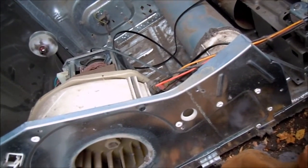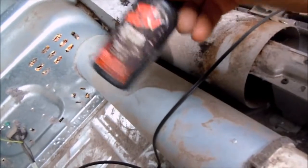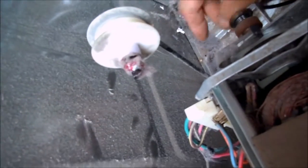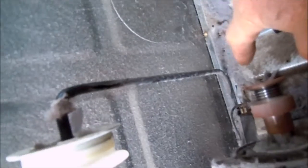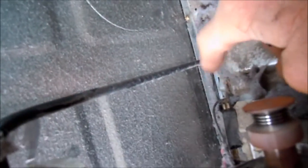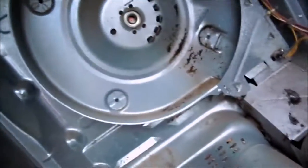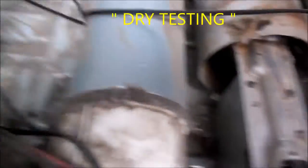Here's the Tri-Flow — this is the superior lubricant. Put a couple of drops here. Now this actually has a switch on it that senses the tension, and there's a switch down there that also senses the tension. If this tensioner is not set to trip that switch when the belt is on, you may have to adjust this or the tang on the switch. If your belt does break, the machine automatically turns off — that's what that switch is for, so it doesn't overheat the drum in one place.